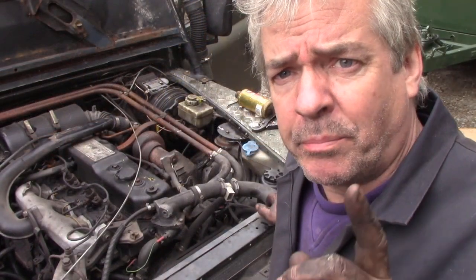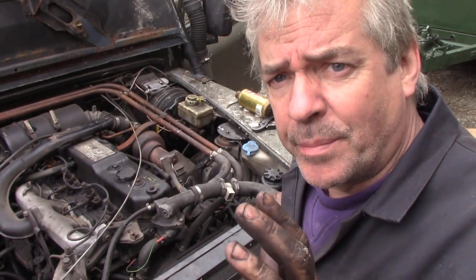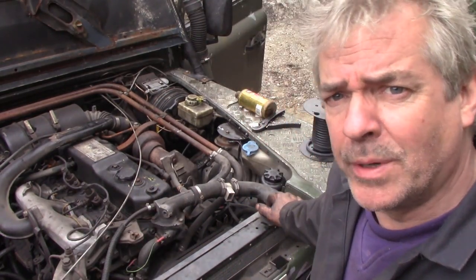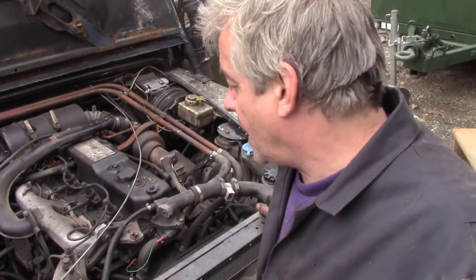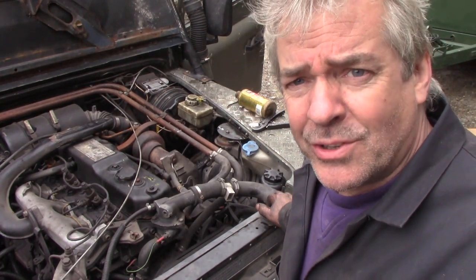So, I can't pull the fork back. So that means the piston is in contact with a rod, which is in contact with the fork, and there's no loose play. So I'm assuming that the ratios for the cylinder are wrong. The Isuzu one was larger. So what I want is something a bit smaller.